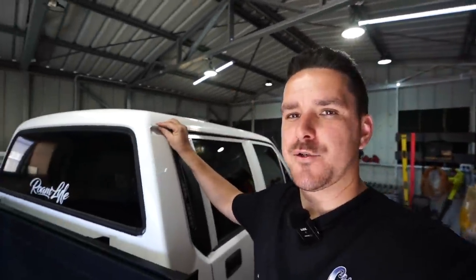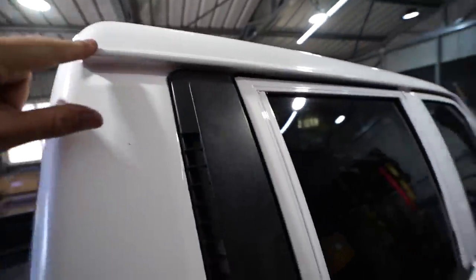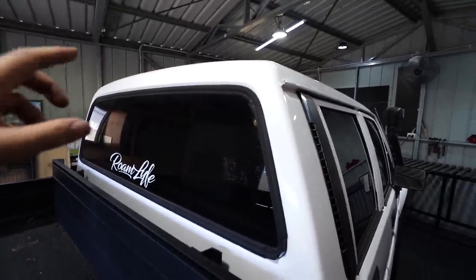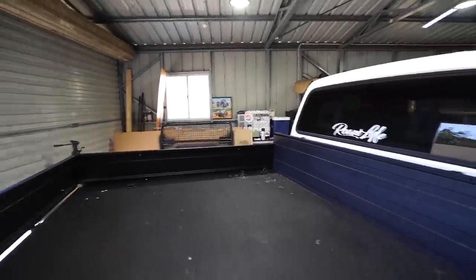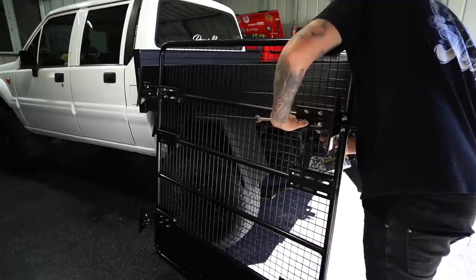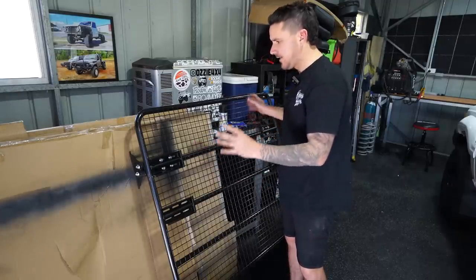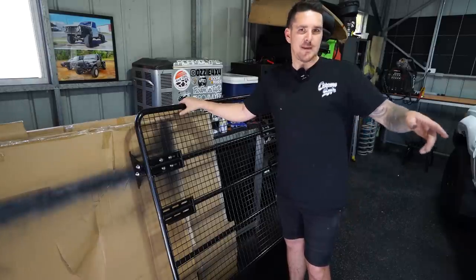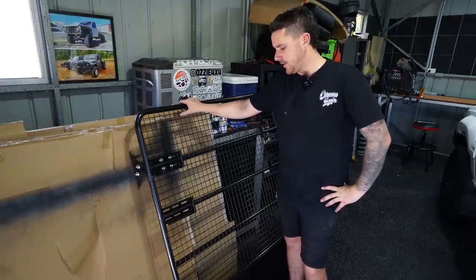Now we have the Triton in the shed. This is the drip rail that we are sandwiching to - one bracket goes down inside this rail and the other comes under and sandwiches it on. What I need to do is measure the distance from here to the other side, and that'll give us the distance we have to mount on our roof rack. The height is a little bit adjustable too, but I want this to be as low as possible so I'll set it to the lowest setting. The rack is now done - all four mounts tidied up, everything's nice and tight, paint's dry, and she's ready to go on top of the Triton.